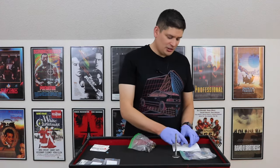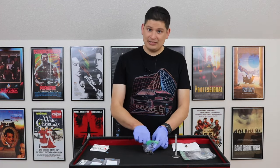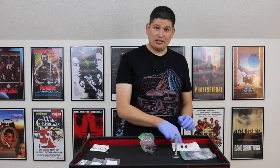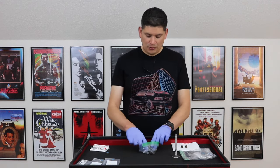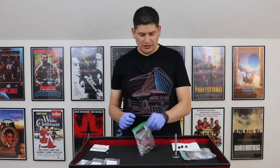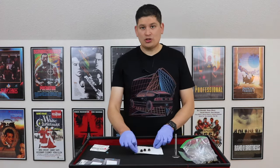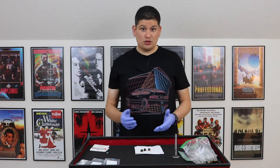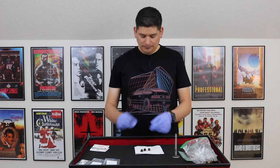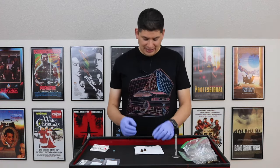So you have intake ones and you have exhaust ones. The reason that makes a big difference is that exhaust has more heat, of course, and they're prone to failure. The type of valve seals used on OEM application, like on a 2JZ GTE, is not going to be the VITON material — it's actually going to be a different type of rubber compound gasket.